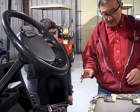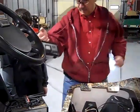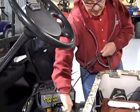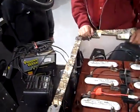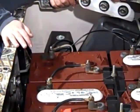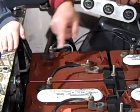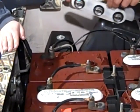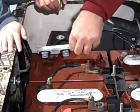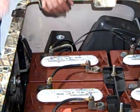I'm going to show you how to make these batteries come back to life. This is a regular 12-volt car charger. You've got to make sure that you've got 6-volt batteries in your golf cart — and in this golf cart, there are 6-volt batteries. You know how I know that? Real easy. When you pull the top off, how many holes are there? Three. Three holes, 2 volts each per hole — 3 times 2 is 6, so it's a 6-volt battery. If there were 4 holes it'd be an 8-volt battery, and if there are 6 holes it would be 12 volts. Very good — you know your math.